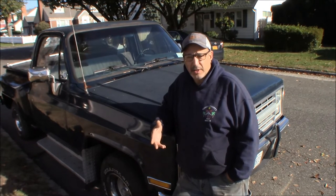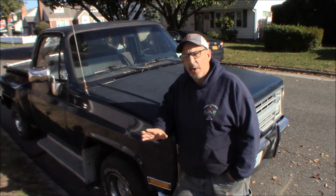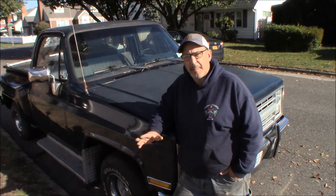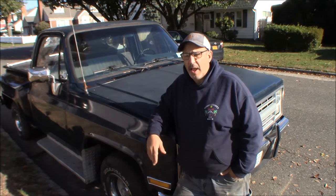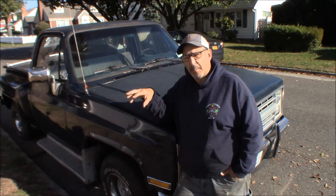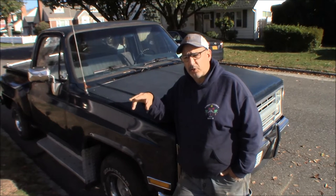It actually started to run a little better as we used it. We cleaned the yard up, made a couple trips to the dump, and everything seemed to be going well. But instead of getting better the more we used it, things actually started to get a little worse. All of a sudden we were experiencing a very long crank time. What I noticed after a couple days was that it wouldn't start until my oil pressure gauge jumped up from cranking, which indicated to me that my fuel pump wasn't providing pressure or running until it got power through the oil pressure switch.